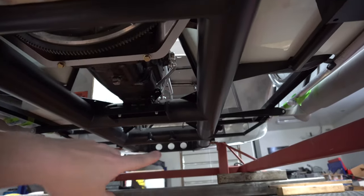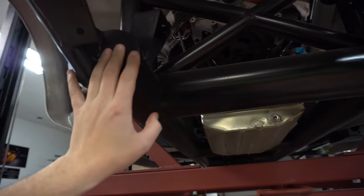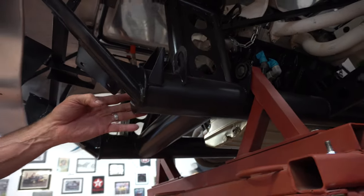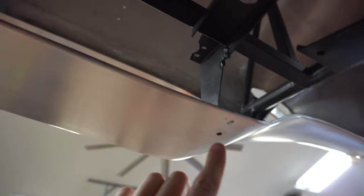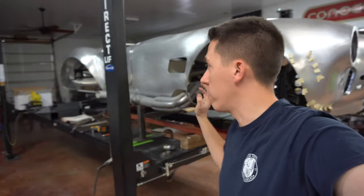Looking under the car, the frames are pretty simple - just round tube with round tube braces that come across, just a few of them across the whole thing. On the old 289 car the tube wasn't even perfectly straight - they can pull in and move a little bit. They'll put sleeves in to strengthen them up. This car looks super straight on the frame. The 289 car had a three-inch diameter main tube, these 427 frames are four-inch. Basic brackets come up to hold the body, and they build little carts to move them around while being built.